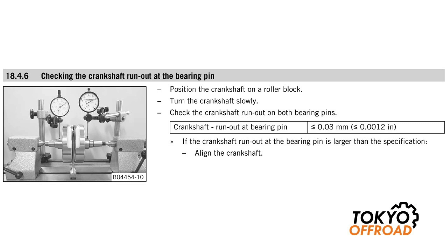You may ask why it's important to have a small amount of run-out on your crankshaft. There are two main reasons. One is if you have excessive run-out it may result in larger amounts of vibration, which is not nice while you're riding. The other is the bearings supporting the crankshaft will probably wear out much faster.